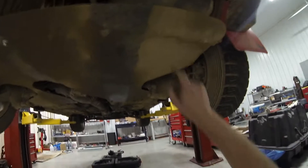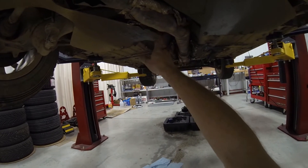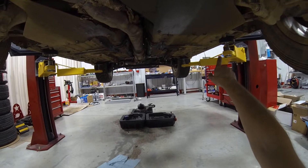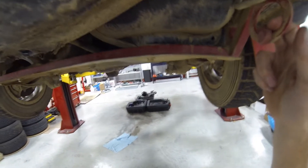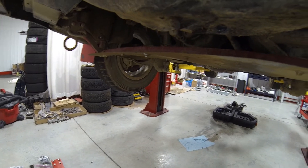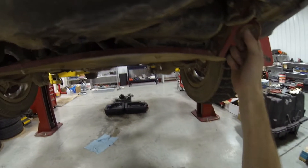Some of the other failure points were: I didn't have time to get button head bolts, so the bolts got hit on rocks. The exhaust wasn't protected well enough, and the exhaust is in very bad shape. There's a lot of damage, and unfortunately everything's riv-nutted, so a lot of these riv-nuts are probably going to fight me. There's just damage everywhere, but the worst part is right here where it got into the gas tank a little bit.